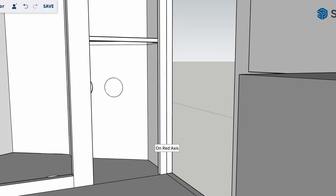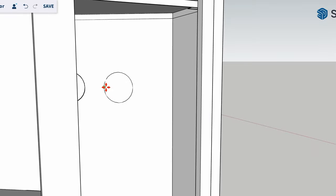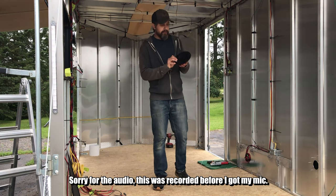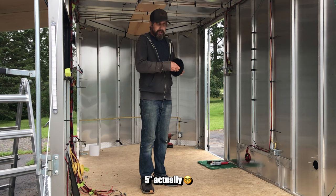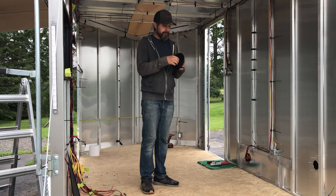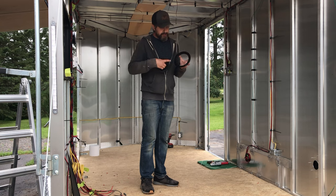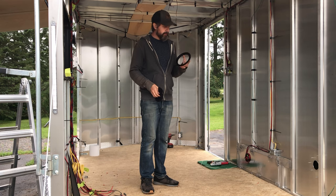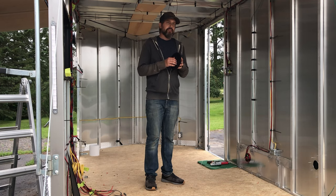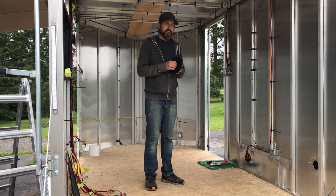The only thing is I have to cut a couple more holes for the vents - these upright air conditioners require an intake and exhaust, some have one port, some have two, and I'm going to do two. I found an access port with a six-inch hole - I liked this one because it's black, has a nice handle to open and close it, and has a rubber O-ring for a waterproof seal. You can find them in many different sizes; I went with a bigger diameter based on looking at various air conditioners online. They're often marketed for boats and marine applications.